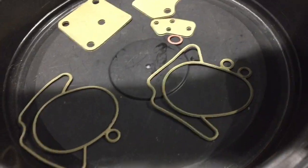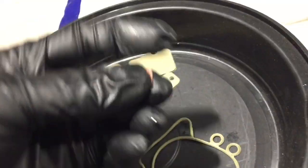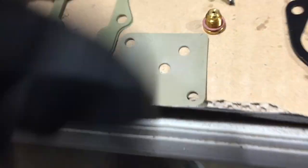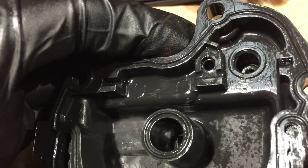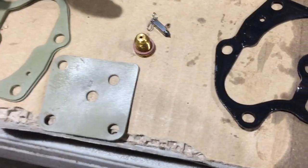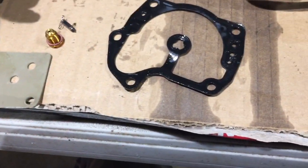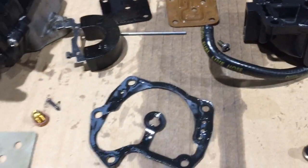My kit came with a bunch of extra gaskets. These are some of the ones for the backside of the carburetor. This gasket here is the one that goes on the seat right down there. Make sure to get the old gasket off before you put the seat back in for the needle. I'll put that in and show you a little video of putting this back together, and make sure to adjust your float level.